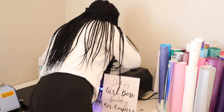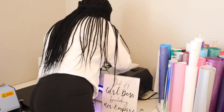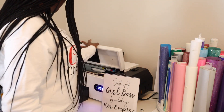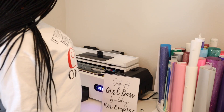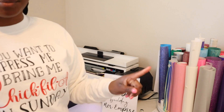Once we have that button on, we'll load our film. In the film, there's a glossy side and a matte side, and you want to be sure to print on the matte side, so we'll load it like this into the printer. You'll notice in the printer, if you have it open, when there's paper loaded it should turn to a blue, indigo, or purplish color. When it's not loaded, it'll be red in the interior light.